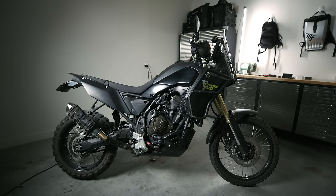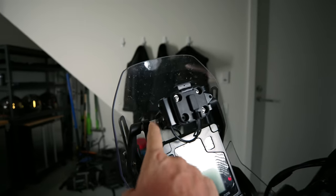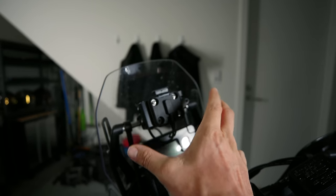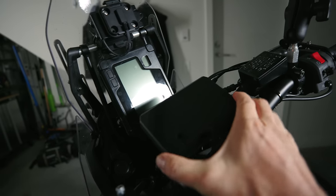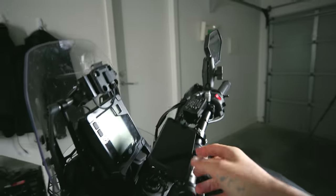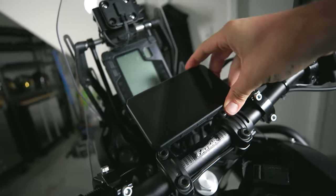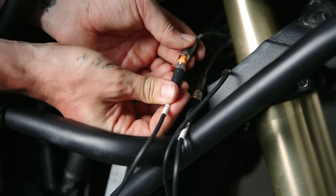Overall, it wasn't a massive job — pretty simple and straightforward. The longest part was routing the cables and making sure you're following the original harness so it doesn't vibrate and wear through and create shorts. That's probably the biggest tip I can give you. I had the plastics off straight away, which gives you a nice bit of room to work with. I've got the unit mounted up to the bars with the 12 millimeter adapter. I might relocate the Garmin and move this up so I can see everything right there. On the back there are little shock absorbers — dampeners — so you can take this off-road and the vibration isn't going to kill it. I've got it all running under there, under the plastics, and that's where all the connections are.